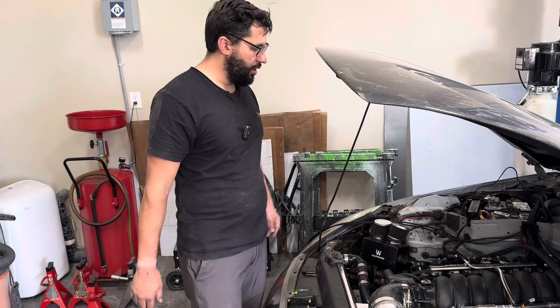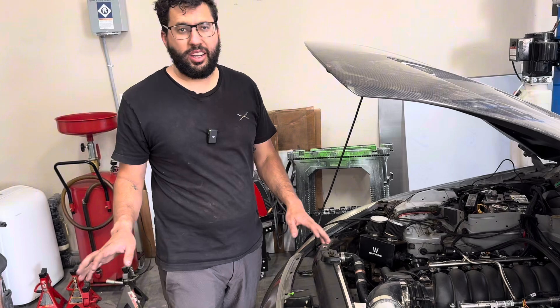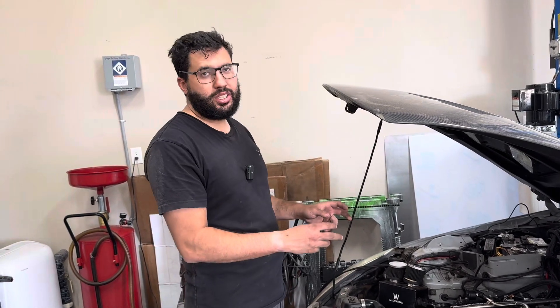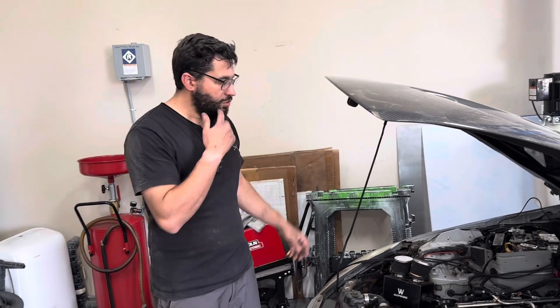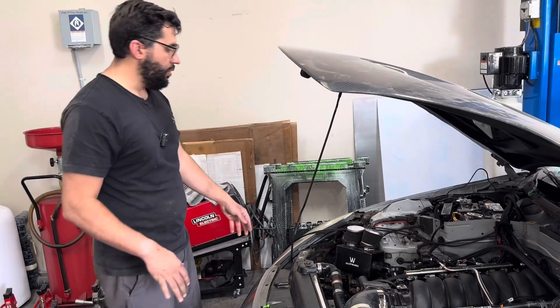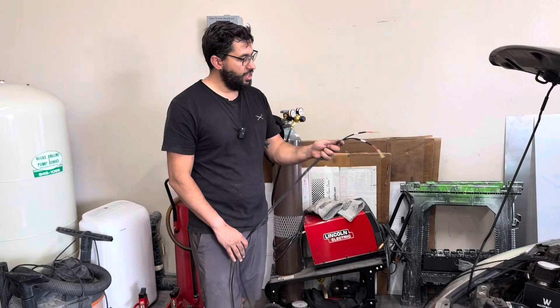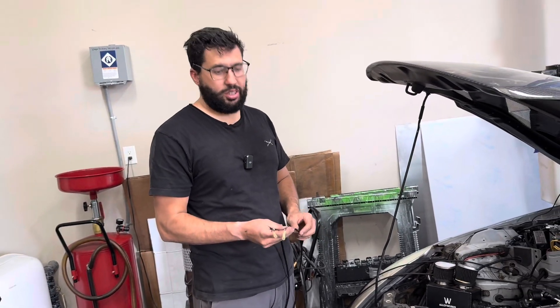The wiring harness is done — we just plugged it in. There was nothing to wire, no crimpers, nothing. You just have to find the right adapter for whatever alternator you have, whatever drive-by-wire, whatever injectors you have, and it all clicks. Sub-harnesses for each one. Remember, the crank sensor comes around and under — and it's a perfect distance. These two are going to be the fans. I'll be running the two Mishimoto race fans separately since they draw about 15 amps each — 30 together — so each fan is on a separate 25-amp load. I'll be able to data log the amperage of each fan, and if one fails, the other can stay on — redundancy. We'll never have no fan.